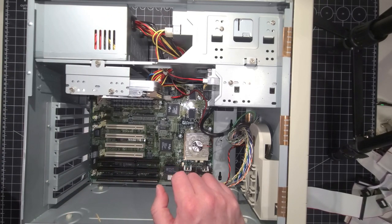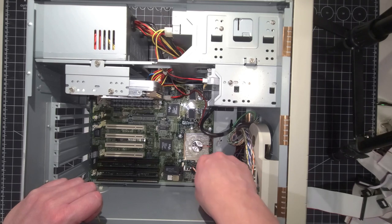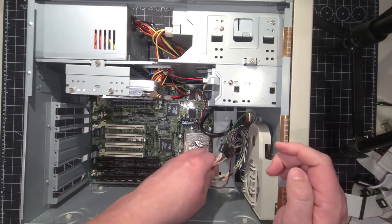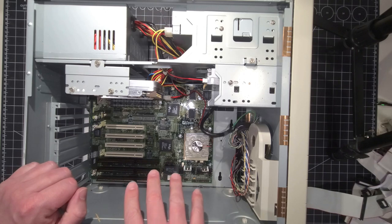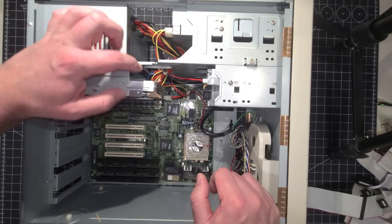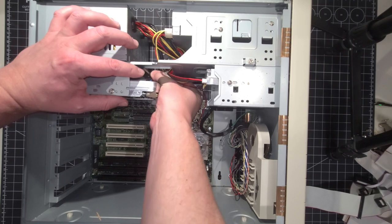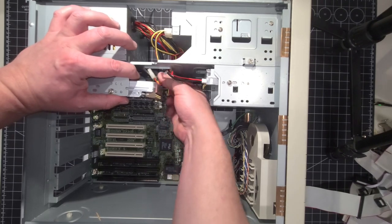We have our IO front panel reset and all those LEDs — we're just going to pull that out. I did take a picture of these, as it's always a good idea because they're always fun in quotes to put back on — it can be a pain trying to put them back if you're working on the system. I'm concerned about this power cable running to the CPU supply here. There's not a lot of room to work with in there with the hard drive, so I think the next logical step is to see if I can just shift this out a little bit.